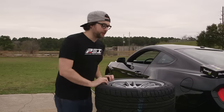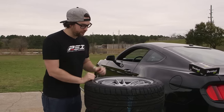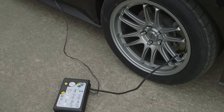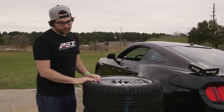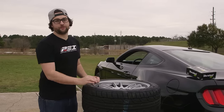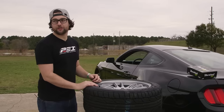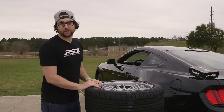You have to go so fast! So obviously we're out here drifting a borrowed car and we don't want to kill the tires that are on it — it might look suspicious. So we went ahead and got some Nitto tires and Drifts wheels. These are a super affordable wheel with good design, good offsets, and pretty lightweight. We mounted some Nitto tires on it — the big thing is to have a tire that's reliable and doesn't fall apart. You can spend less money on an inferior tire, but you might only get a few laps before they fall apart. These Nittos take extreme abuse and a lot of heat, and with a stock car at full weight, we needed a tire that supplies good grip and is easy to drive to teach you guys.